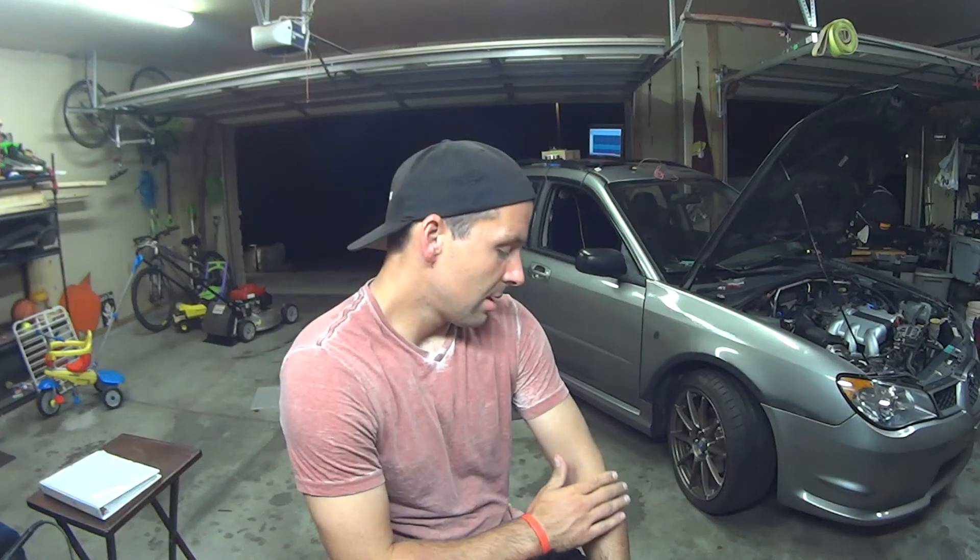We were debugging the wiring into the engine bay to figure out what was going on with the coils. We had a theory that the SVX coils required 12 volts and the ECU was only doing logic-level 5 volt. So we switched to LS2 coils which my friend just had laying around for his Corvette — he kindly brought those over and we wired them all up. From there we still didn't get any signal coming out of the ECU to the coils, which led me to take apart the ECU and look it over. Not long into that I noticed I had the ribbon cable for the MS3X backwards, so all the signals were going somewhere else. Once we turned that around and wired up those LS2 coils, we actually did get this thing to fire up last night, which was a win.